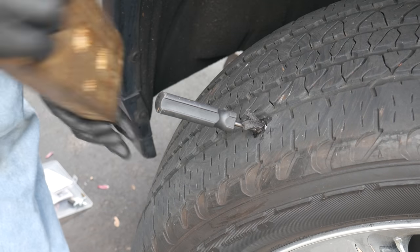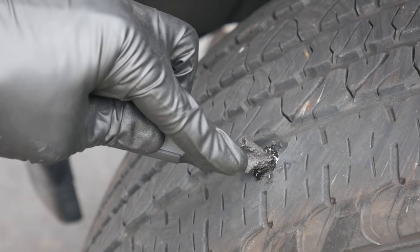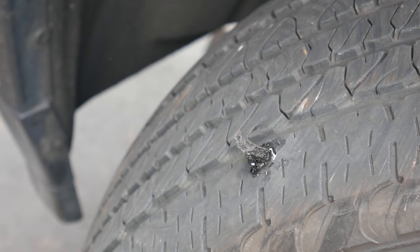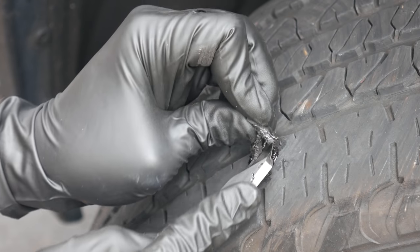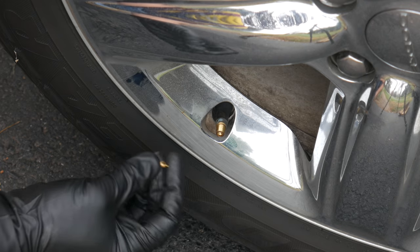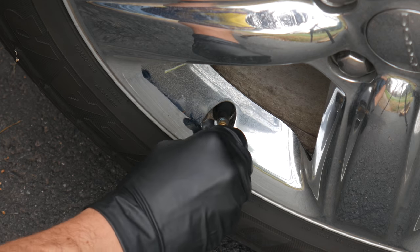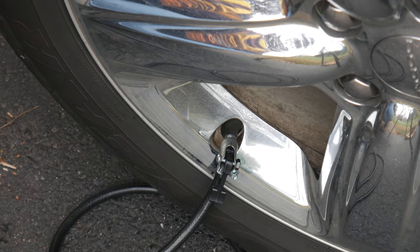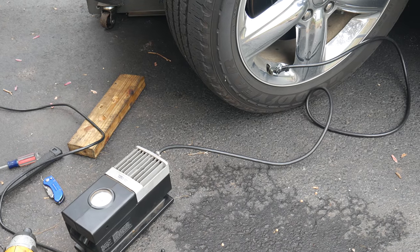Once the eyelet tool is pushed about all the way in, we know it's pushed all the way through the tread of the tire. On the outside of the tire, the plug should still be sticking a little ways out of the tread. Then we'll turn the tool 90 degrees and try to pull it out in one smooth motion. If all went well, the tool will pop out and the plug will stay in the tire. We'll use a razor blade to trim down some of the plug, but we still want to leave it above flush with the tread. We'll let it sit for a little while before driving so that the rubber cement has a chance to dry. In the meantime, we'll use our little tool to reinstall the valve core — this should be snug, but not super tight. Then all we really have to do is put air back into the tire, filling it back up to 36 psi. All of that air pressure against the inside of the plug should help it seat even better while the rubber cement dries.